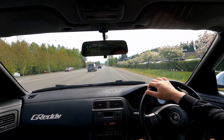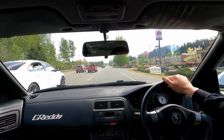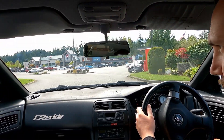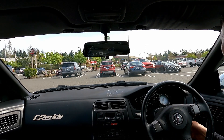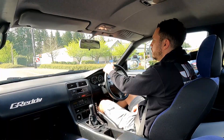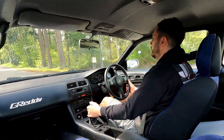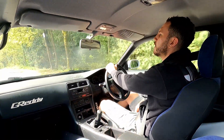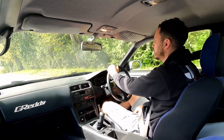The clutch is sure stiff. The car feels solid, though — brakes feel good, chassis feels good with the new tires on there. Handle's good, no rubbing. Doesn't hold first gear, so I'm not sure what that means — there's just more stuff to fix. I've got to change the transmission fluid and see what it looks like in there. It could be that the synchros are worn, but if you're in first gear and you start to accelerate without holding your hand on the stick shift, it'll slip out of first gear. I've never had a car that's done that before, so let me know what you guys think. This thing still has a lot of work to do.